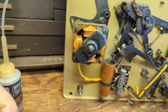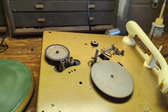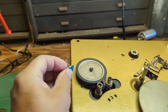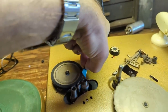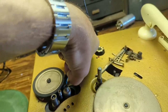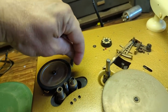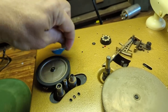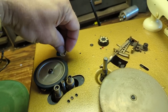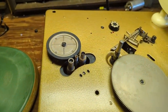Need to oil the bearings on this first though. Now we've oiled everything including the motor bearings. We want to get the idler wheel kind of roughed up a little bit. So I just get a little sandpaper and do this. The platter is not on it right now, but we want to roughen it up a little bit so it makes a good strong grip with the platter, assuming this has not shrunk too much. I think it might be okay, so I'm going to turn it off and put the platter back on and see if it grips.